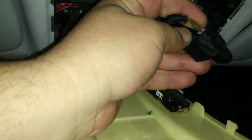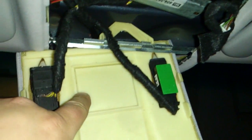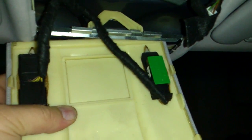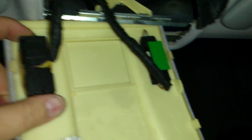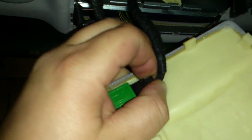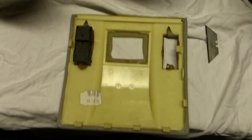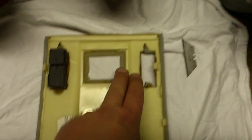So what we're looking to do is get this out. I'm going to go ahead and cut this section out, which is already pre-cut, and basically when that's popped out we can go ahead and install it. So I'm going to disconnect these, which should be just a simple pull out like that, and then we'll go ahead and start scoring the inside of the panel to get the HomeLink in there.